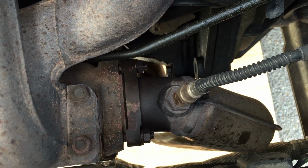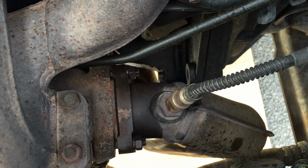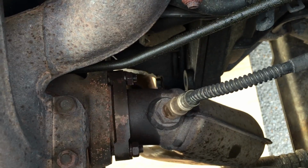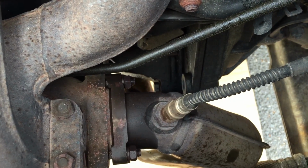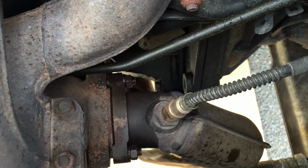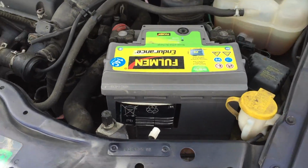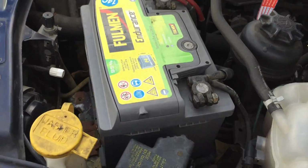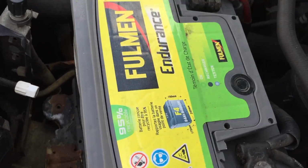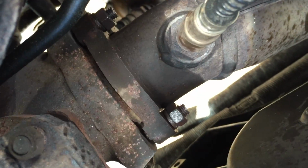Okay. Of course, once again, put penetrating oil before you unscrew. And if you feel there is a resistance, do it like I explained before, okay? I've got to tell you that if you work on the engine, first of all, disconnect the battery. Okay, now we will unscrew the two bolts on the exhaust.